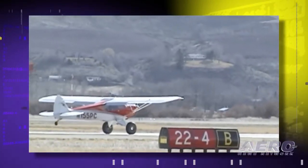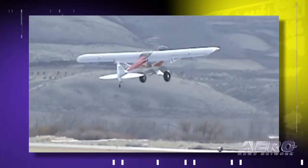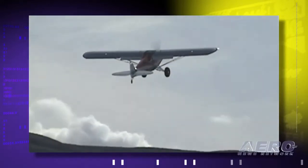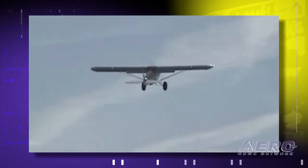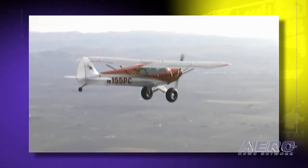It doesn't matter if it's a home-built. We compete with those guys at Valdez, and we're the ones to beat — whether it's LSA, standard category, or experimental home-built. This is an LSA-legal, factory-built airplane. For the utilitarian fun machine, we can cruise along at 105 to 115 mph. I tell people to expect 95 to 105, and nobody's called me a liar yet, but realistically you can go faster. The sweet spot is about 110 miles an hour burning 5 gallons an hour.